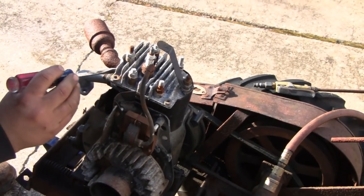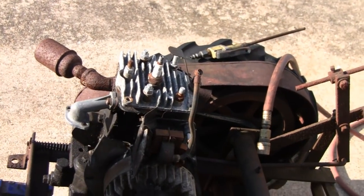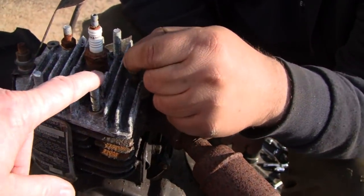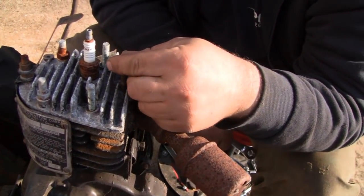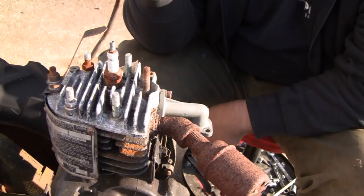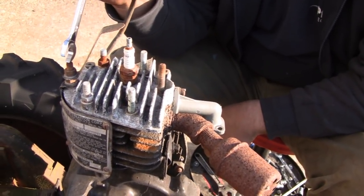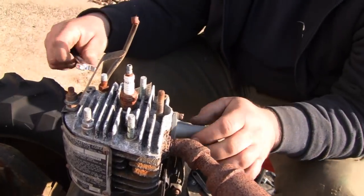Yeah, it looks like there's some epoxy or silicone or something in the head here. Oh yeah. So we're going to find that next. Maybe this may be junk, but if it can run, we'll get it running. That's right. Even the head is sort of hacked up a little bit, because all these are supposed to be bolts, and they actually turned them into studs, Mike? Well, yeah, another weird thing is, if I'm not mistaken, on all of these engines the head bolts are a coarse thread, like 5/16-18, and he's got what looks like 5/16-24 studs here, but then he's got a 5/16-18 stud here. I really don't know. This is just the plot thickens. The mystery deepens, I guess.